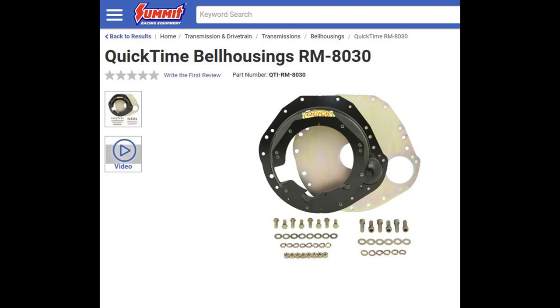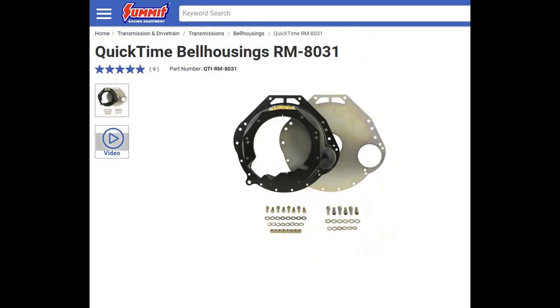These are both 157 tooth flywheel bell housings, the only difference being that the RM8030 has a 9 o'clock opening for a clutch fork, and the 8031 has a 7 o'clock opening. But in my case, I don't use a clutch fork. I have a hydraulic throwout bearing, so the fork location doesn't really matter. But I did get a quote from three different vendors, and they all quoted me one of these two bell housings. And after installing the transmission in the car and finding that they clock the transmission like this,